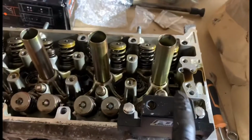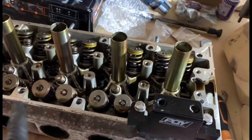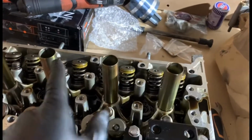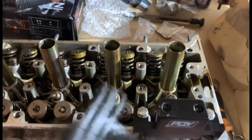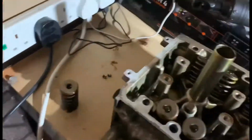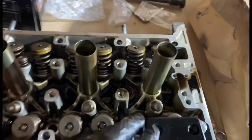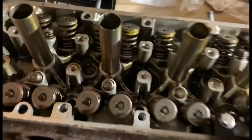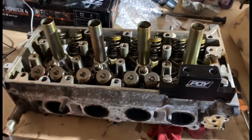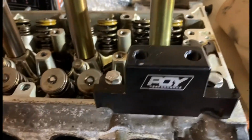Usually guys, when you do this, make sure you mark each valve. So your inlets you do 1 to 8, and your exhaust side you do 1 to 8, and make sure they're all in sync. Just to give an example, I'm changing valves and springs also don't really matter, they're all going to be newly lapped in anyway. But you do 1, 1, 2, 2, 3, 3 and so on. Make sure you label everything and you get it right. That's the tool that you need.